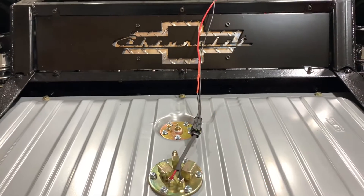Now we've transitioned to our larger gauge wire. A lot of people watching are probably asking why I didn't use a butt connector — I love butt connectors and use them all the time, but when transitioning to a larger wire you kind of have to double up the thinner wire since they only fit one range of wire size. When you solder it, it's just one connection, one wire, forever, and you don't have to worry about a connection coming loose because it doesn't quite fit the butt connector. Whenever I'm transitioning from a small gauge wire to a larger gauge wire, I like to solder it instead.